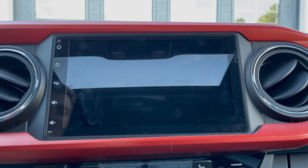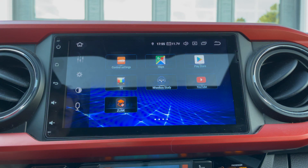Now that we're back over here in the truck, I recommend you don't turn it on, because the interactions that happen between the head unit and the CAN bus of your vehicle, depending on what you have, could cause some issues. This is going to be done on my 2016 third gen Tacoma, and anybody that's got one should work pretty much the same. So just press your start button twice to bring on your in-vehicle power but nothing else, and then all you'll do is take the flash drive and insert it into the USB port that connects to your head unit.